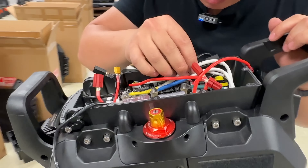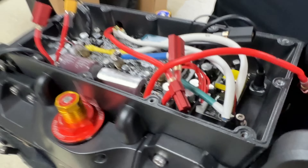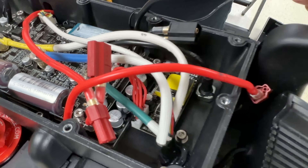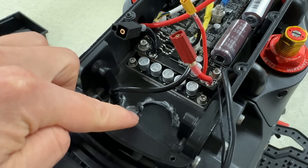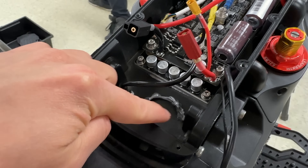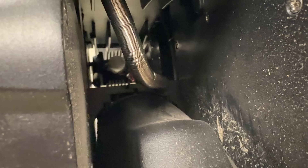It's still a daughter board — a separate daughter board. We're wondering if they had a buzzer previously mounted there, and then maybe realized it wasn't loud enough, and then mounted it under — over there, that white thing around the back. That's why it's quite loud; I can hear it no problem. That's also the way the new Begode wheels have been doing it — the Master, Master Pro, T4 — they're all mounted behind the headlight.